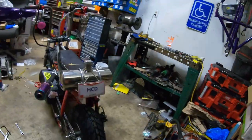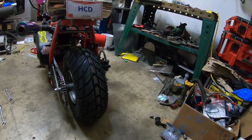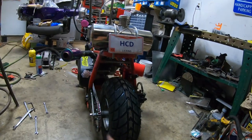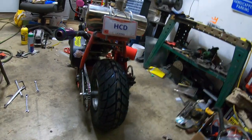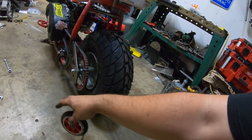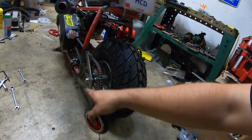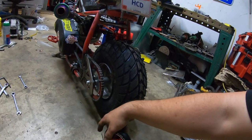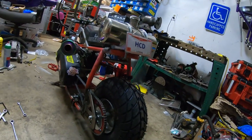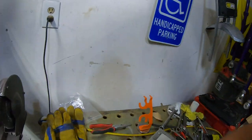So if this thing really bucks hard, I'm going to try to build a set of wheelie bars that comes out probably about here, out of some tubing that I have. And I'm going to see if I can't put some tabs on the frame up there, run the bars down so I can adjust them up and down. And then I'm going to put a couple holes, or like one hole here, hopefully. May just weld a tab or something onto it for now, because I'm going to cut this one back off and redo it since my logo is backwards. But then I'm going to run a Heim joint there. So then I have a triangle that goes up from here back and then straight out or ish to help me not pull the front tire off the ground. So we'll see how that goes.